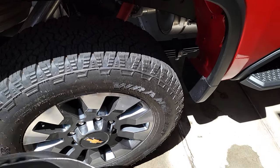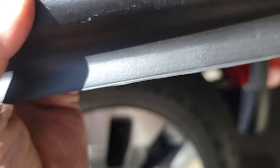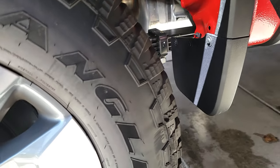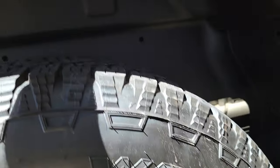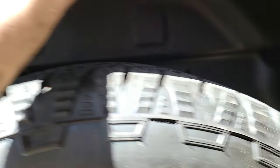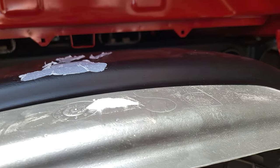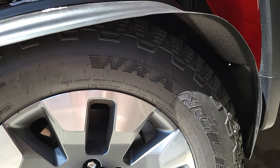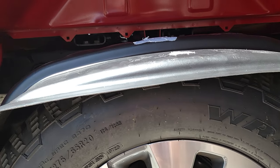Let me show you quickly what I mean — bottom first. This kind of goes in and over the tire first like that, then you're bending these corners in to get them to go in. Pause it and bend it around the tire, then push it up in there and work the edges. You don't need to attach any fasteners ahead of time. You can use those fastener clip kits to hold them on, but the goal is to get away from bolts rusting, which is why you want to use those plastic clips — there won't be any rust coming down this black piece.